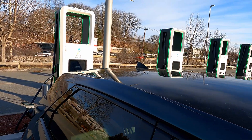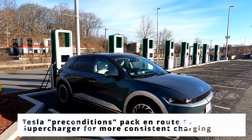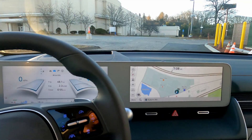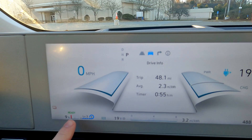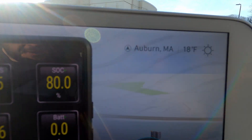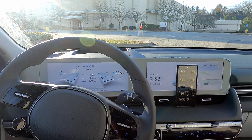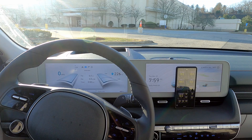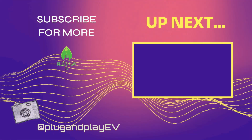You do get similar power towards the end, but that's after a lot of battery heating and a lot of work by the car to get the pack temperature up to speed. The main takeaway: almost twice as long a session, which is not unfamiliar to EV owners. This speaks to Hyundai's ability to work on battery conditioning in the software in future updates — whether they can trigger that when navigating to a DC fast charger, or let the owner manually toggle it on before charging to offset that slower start. At 18 degrees Fahrenheit, going to 80% state of charge, even in frigid winter conditions, that is not terrible performance by the Ioniq 5.